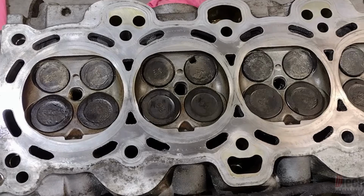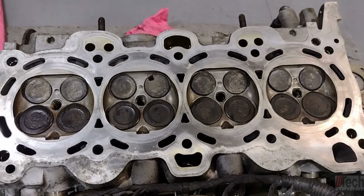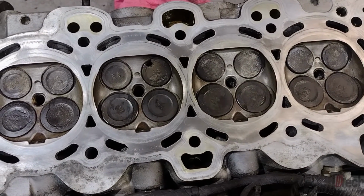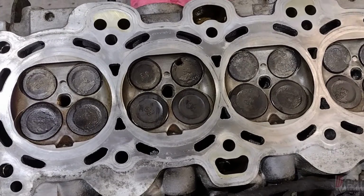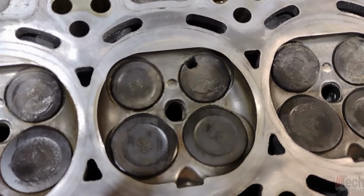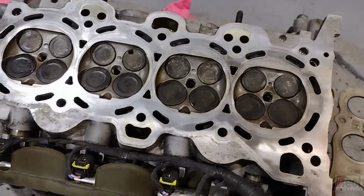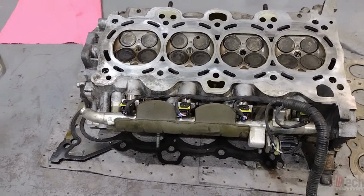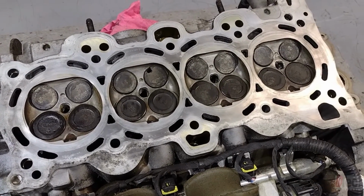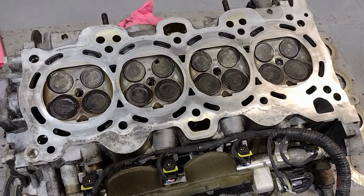is that guy there. Now, obviously, I can, as you saw in the cylinder block, I've cleaned off, and I've cleaned off here the cylinder head just to get a good view. But we do have a piece of the exhaust valve missing. So we obviously can go forward with repairing this and restoring compression and avoiding having to replace an engine.